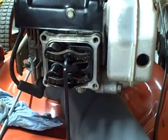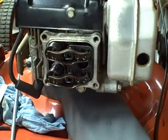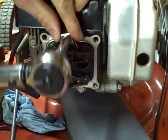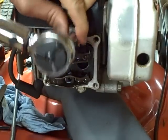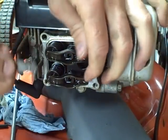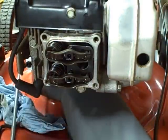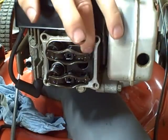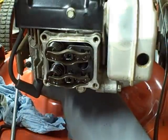I'm not going to tighten it too much. These lock nuts need to be tightened to 120 inch-pounds, so I'm going to torque them down with a torque wrench. Then I'm going to recheck my valve lash. The final thing to do is rotate the engine around and make sure there's no binding with the push rod, then come back to your original position and recheck the valve lash.